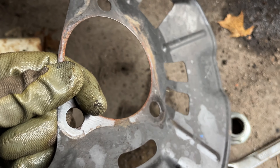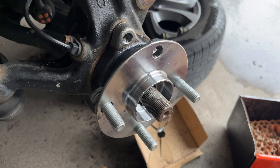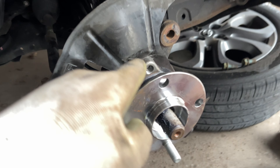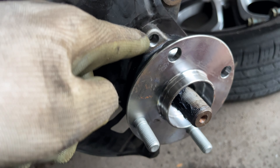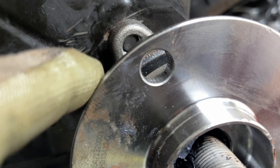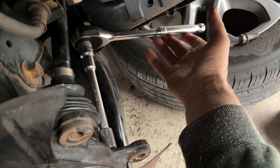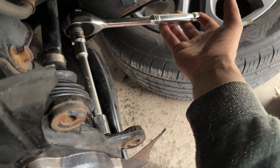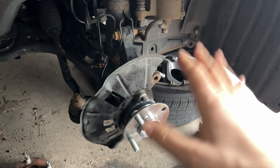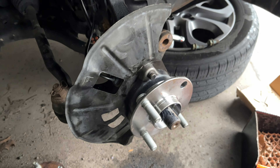What I forgot was the backing plate. Now I gotta pound it out. The best way to line these up is right here — take these guys out and as you can see, you'll line them up right there. About 10 pounds of pressure — you want to get it tight, but not really really crazy tight.